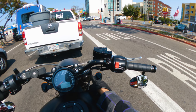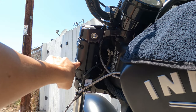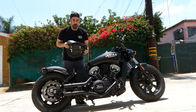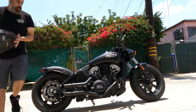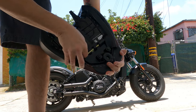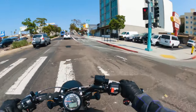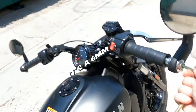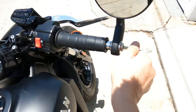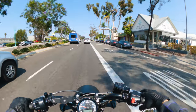You're going to want to do these three screws on each side — it's an Allen wrench. The Allen wrench is actually underneath the seat. If you have a stock Indian Scout Bobber seat, and if you didn't know this or had never looked under there, there's actually an Allen wrench under there. It works to take off the headlight cowl. Also, it works on your bar ends if you want to adjust your mirrors. The other side of that is the screwdriver, so you literally only need the tool that's underneath your seat to do this.